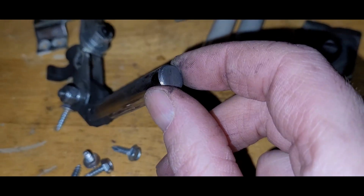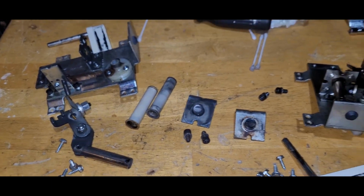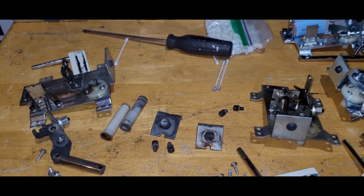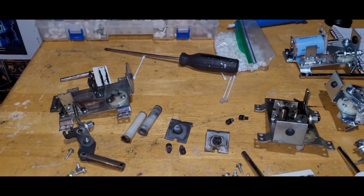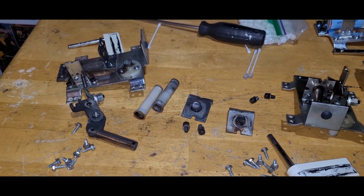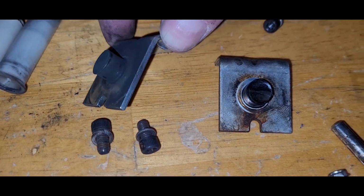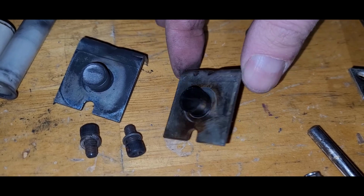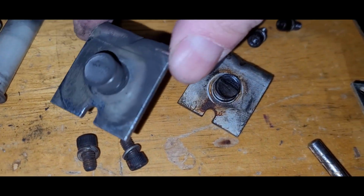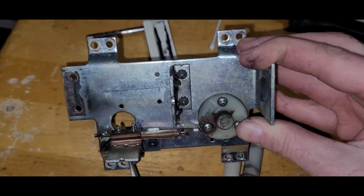The plunger tip isn't actually that bad. So I think what happened here is that someone thought the flippers weren't working very well and just changing the coils would solve the problem. But it's very often not the coil's fault. You can see the coil stops are definitely concave and just nasty in general. Yikes. And here's the whole flipper base.